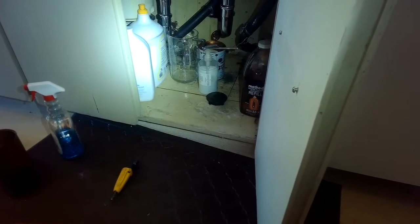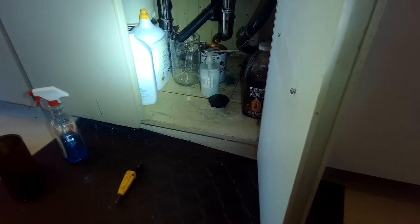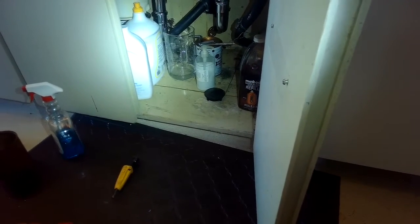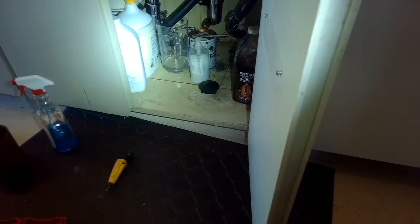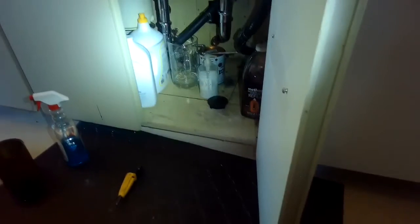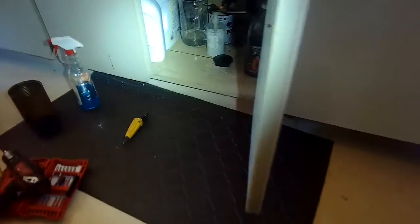Now we can actually see the water pulsing into this little glass beaker. It starts, it stops, starts, stops. That's normal. And I think it's on the 3rd or 4th time. It'll just continually drain, drain, drain. And that's exactly correct for the Bosch dishwasher. Also the Miele dishwasher does that too.